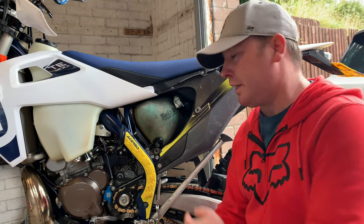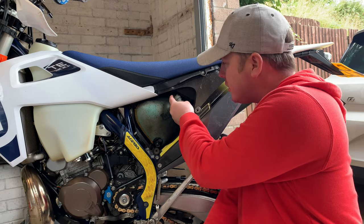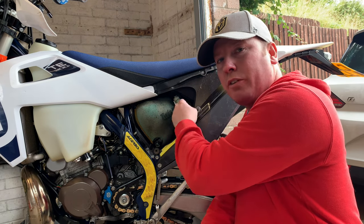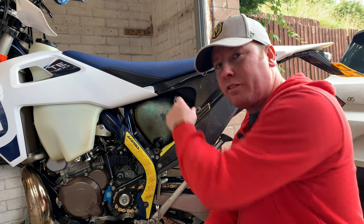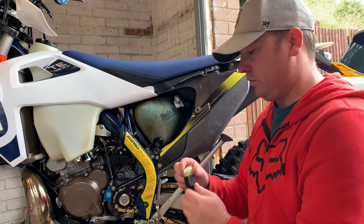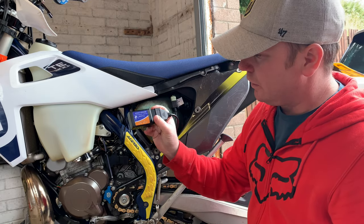When it comes to connecting it to your bike, your 6-pin connector is covered by a little cover that looks like it could directly connect to it, but you can't — you just have to take it off. Mine is there where the filter is, but according to the manual they should be up under the seat and underneath the ECU. If yours isn't there, you'd have to take your seat off to get to it. So you just remove the little cap and connect it on like so and it's ready to go.